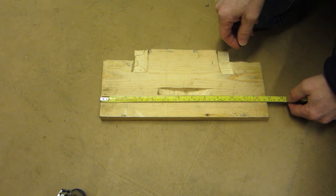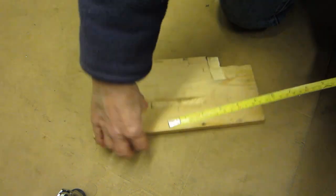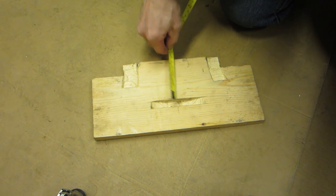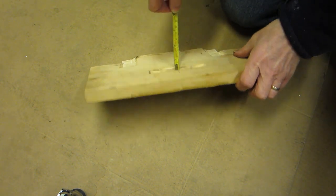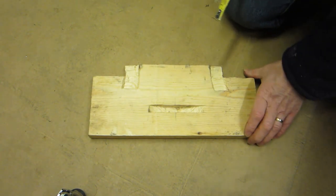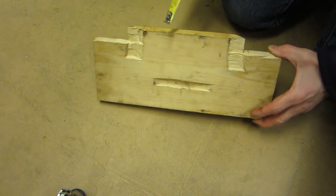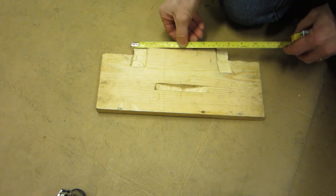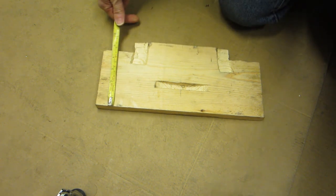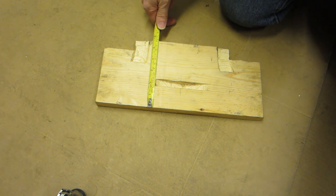The block is 325 millimetres overall and 20 millimetres thick. The brake disc groove is about 110mm long by 15mm wide by 14mm deep at the deepest, and I've reduced that down to about 15mm here. That section is just under 200 millimetres, the width is 115mm there and 140mm nearly there.